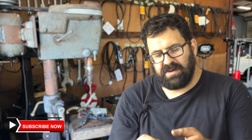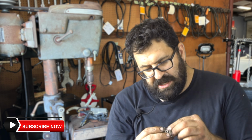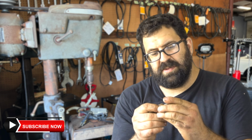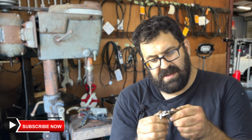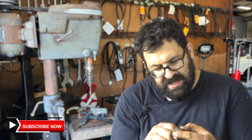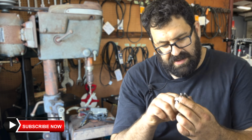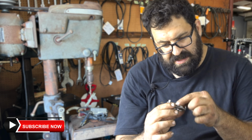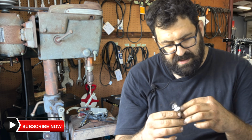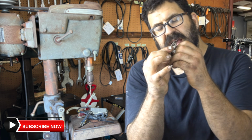of a breaker plate situation where the inner diameter of these breaker plates has gotten to a point where, instead of rotating nicely and working smoothly together, play has developed. I'll show you where that play is as soon as I get these things to fit together. See this pin right here? I'm trying to get it aligned with this hole. This is the vacuum advance path.